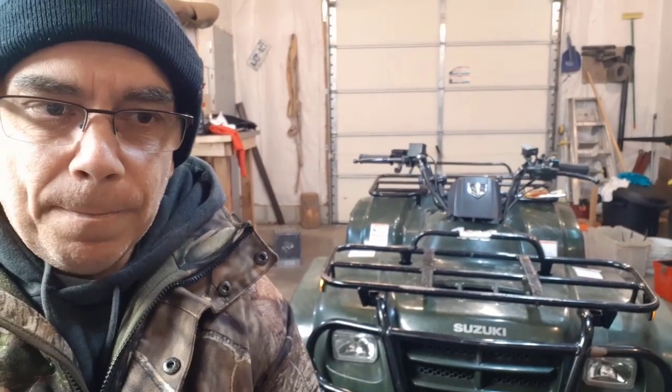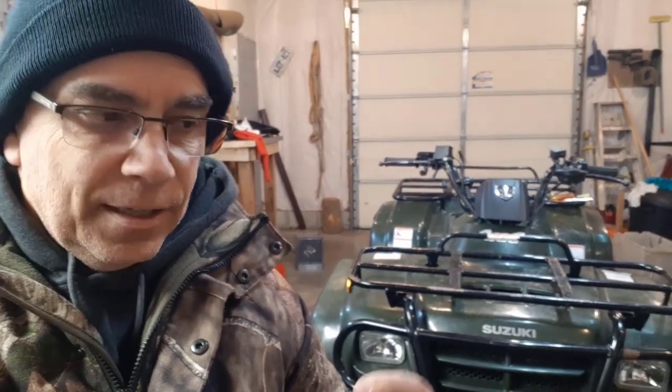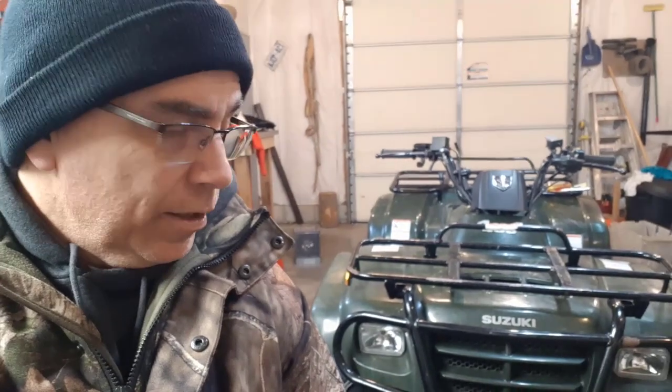So I did a little plowing around the yard and it worked great. Yesterday, I went to take out my ATV. It started, ran good, and then it died. It was a bit hard to get started, but I got it going. It runs great as long as you keep your thumb on the throttle, but as soon as you let off, it idles for a couple seconds and shuts off. I figured I had a carburetor problem.